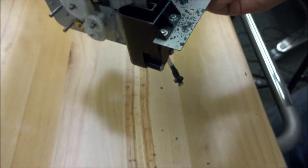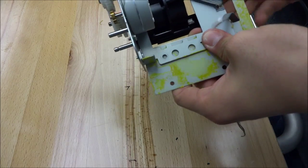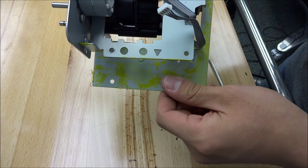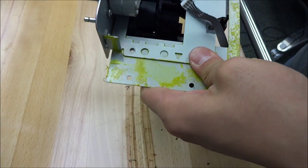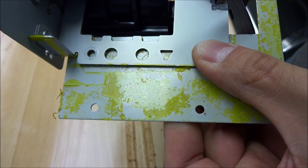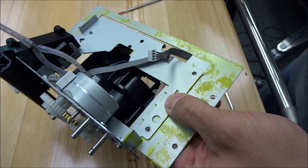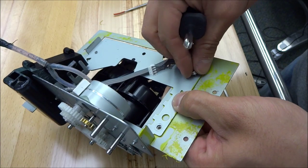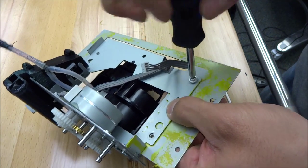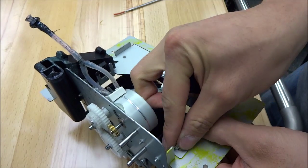You have to hold this while trying to screw in your mount, so usually two people would help. There's a second part: if you flip this around, we have our underside. All along this bracket there's a raised circle that would go into that one right there. Same thing — it can't be like this or like that, too far down or too far up. It would have to be right, pressed up against it. This is where my stubby screwdriver comes in if you don't have anyone helping you. The screws go from the underside up — don't get confused, they don't go topside down.